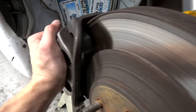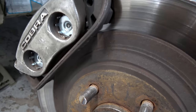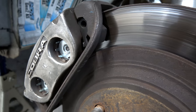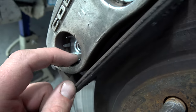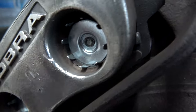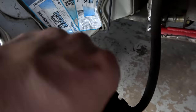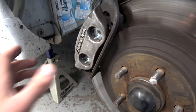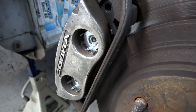So the issue is — it's a full floating caliper, you can see it kind of just floats around in there. I don't know exactly what the deal is, whether it's the bracket or the caliper itself, but it just makes an awful clunk clunk clunk at any kind of speed. I don't know if there's excessive play or what, but typically what happens is it ends up breaking these little nubs off the pads, and then the pads just float around and make a racket. So we'll just replace it all — about $200 to get a remanufactured one. It doesn't even say Cobra but honestly it doesn't matter, we just need to get this thing working right.